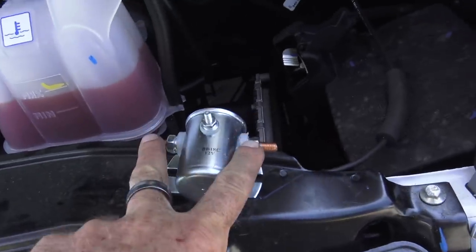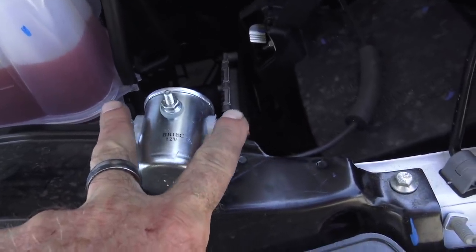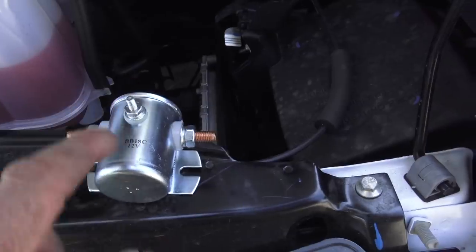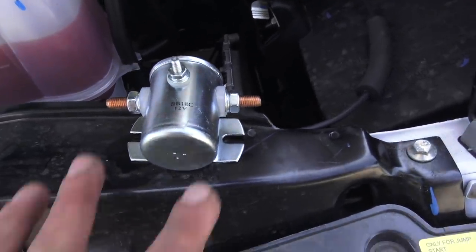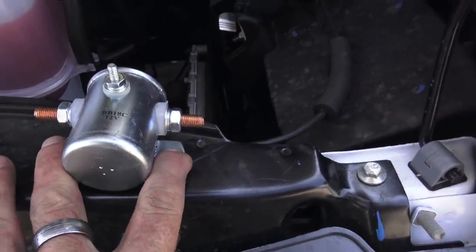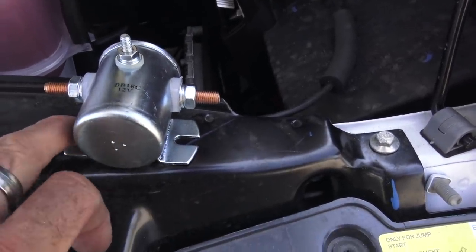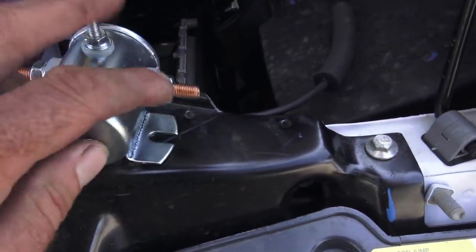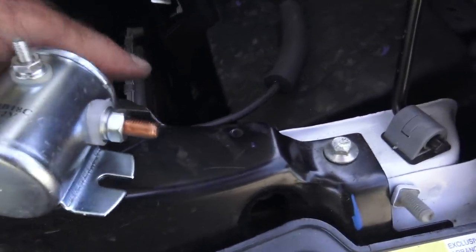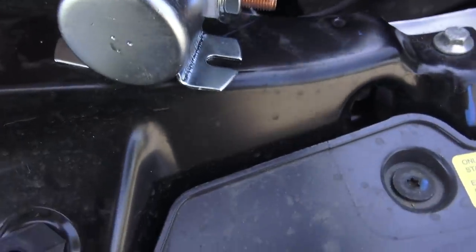You've got two here, which are going to be both positive cables, and one on the top. There should be a fourth. In the case of the way this one was engineered, the fourth are the mounting spots here. We need to scrape the paint off on both sides of this and mount it with some self-tapping screws, and check underneath to make sure we don't penetrate a radiator.